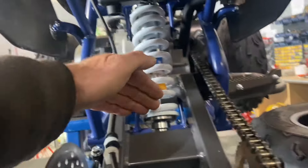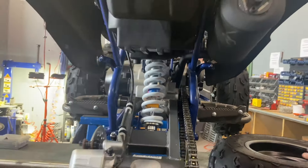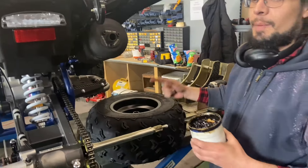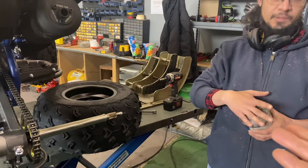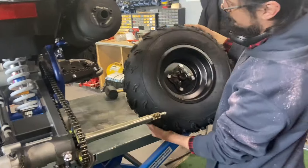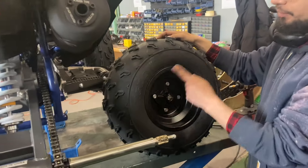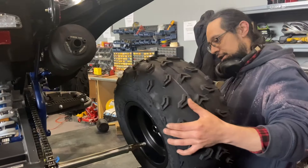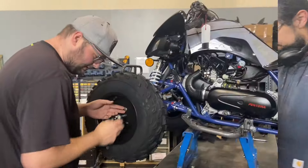Keep in mind that your wheels are directional, so make sure you put them on the correct side. The directional marking is on the tire tread — there's a rotation arrow that shows which direction the wheel turns. You can also see the tread pattern — these little chevron shapes indicate directionality. Keep that in mind when doing this at home.